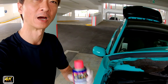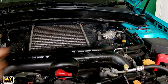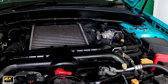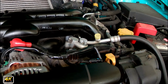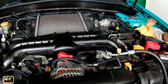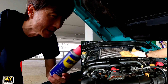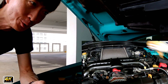For the last tip: I will use the WD-40 lubricant on the engine bay, but not on the connectors — this is how you should do it. Both are wonderful WD-40 products. I use the lubricant to wipe down plastics and metal parts, except the cables and connectors.